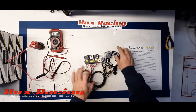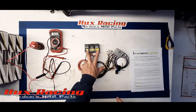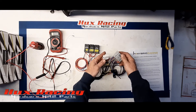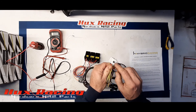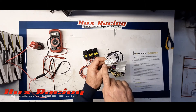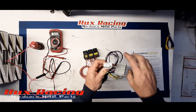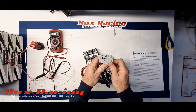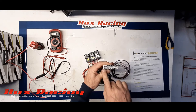This is that exact same harness but I've labeled what relay is what, which connector is which, and what the pin locations are. This is the E-connector at the K-series ECU. That will be pin 1, numbered 1 through 9 across the top and then back to 10 over here. This is C101 — that will be the pin 1 location.